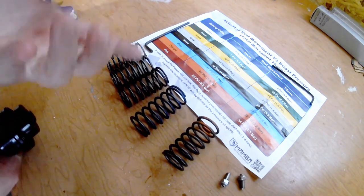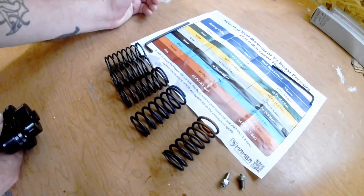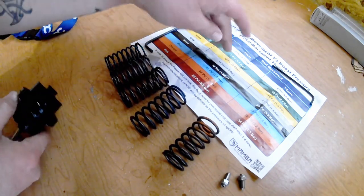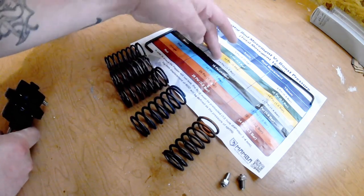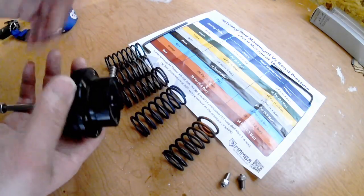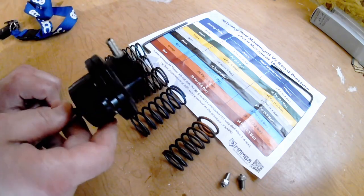I'm currently typically maxing out about 23 to 24. So 12 would be perfect for that. So basically, if the boost controller is sending 100% of the signal, I'm gonna get 12 PSI of boost max, essentially. Well, probably 13 or 14 max on wastegate. So I'm gonna pop this thing open, we're gonna clean it out, make sure it's the yellow spring, and then we'll throw it on the car. So, yeah.